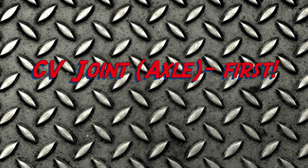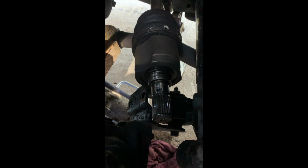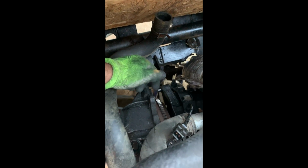But they do work. I'm trying to get this weird shaped transmission off. You're going to pry a little bit there, and you're going to pry a little bit on the other side where the starter is, to make sure that your CV joint for the passenger side slips out. So work that out as you go, as you're pulling the transmission out. There's a CV joint there. There's a pin down there. Work those out. There's another pin there. It's about a 1/2 inch wide pin that lines the transaxle up with the motor. Here's your flywheel. So as you're prying those apart, make sure that your CV axle goes out, and then you can rest it on the motor mount bracket over there.